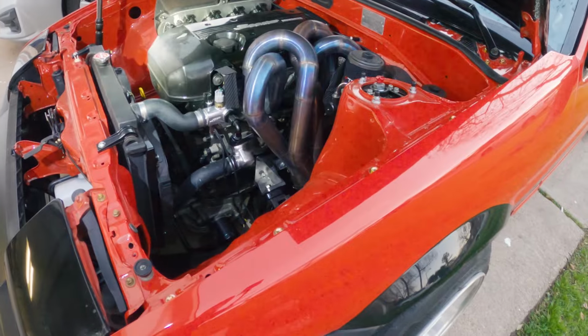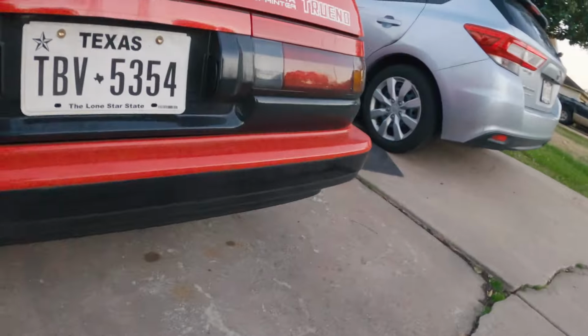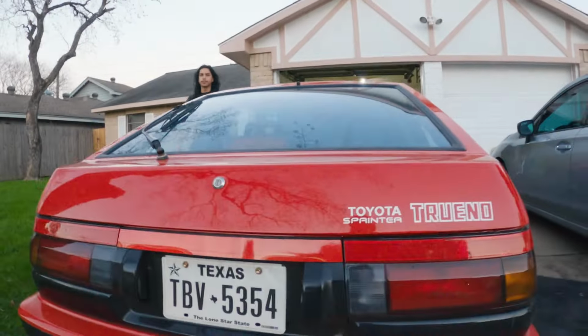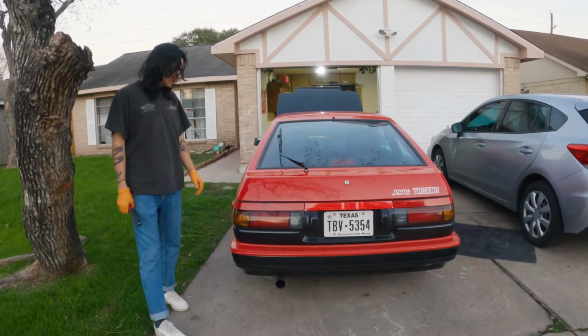Little rear Breeze Fab links. You can probably see them from down there somewhere. Wait, what color are yours? They're just the silver ones. Oh, okay. So they're just the normal, non-powder coated ones. I have half poly and half Heim. The ones on the chassis are poly and the ones on the actual axle are Heim. What Panhard bar do you have? Also the Breeze Fab, yeah. Oh, okay. So I pretty much have the whole Breeze Fab setup in the rear. Pretty nice. Lots of adjustability.